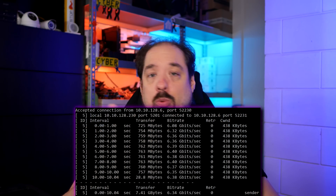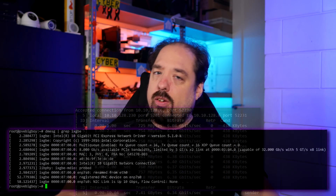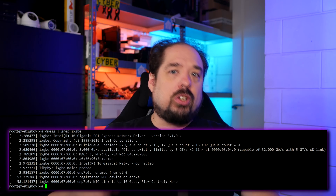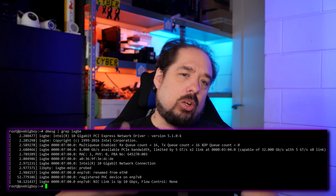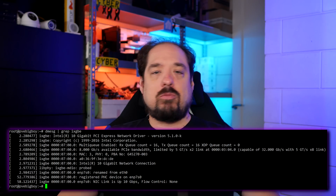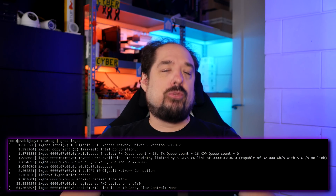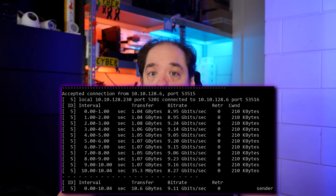As you might know from earlier in the series, I kind of ran out of PCIe lanes because I'm using a desktop board, so my 10 gigabit NIC would be limited. During testing between my workstation and server, this limit did indeed show up. In the dmesg log, you can clearly see that the Intel network card is only using two PCIe Generation 2 lanes, which is about 1 gigabyte a second, but because of the overhead with PCIe Generation 2, that equates to about 600–650 megabytes a second in reality. The fix for this was always in the back of my mind — once the server was fully up and running, I just pulled out the graphics card. That made it so the bottom slot had the full four PCIe 2.0 lanes, and thus 10 gigabit was achieved without a problem. It's been running like that ever since — not a single crash or issue, and it's been perfect.